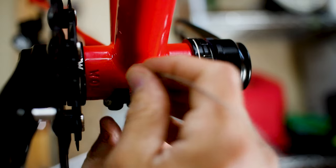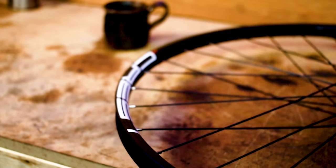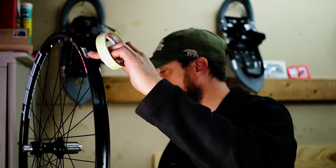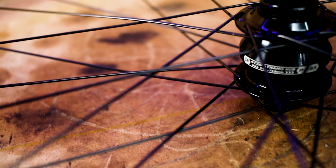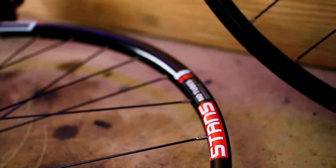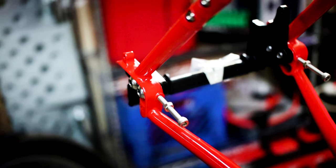Let's get the front and rear derailleurs installed and then on to the sexy part of the bike. I'm going tubeless with a set of Stan's NoTubes Crest Mark III rims. I fitted the front with a Shutter Precision Dynohub so I can run a light and possibly a USB. The rear has a White Industries center lock disc hub. These rims and the hubs built around them weren't cheap, but they're strong and stiff and will last for years. The Stan's Crest Mark III will allow me to put on wider tires that the Wolverine frame has room for.